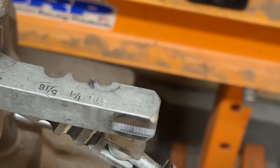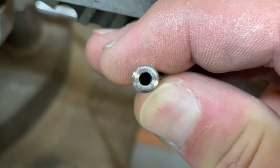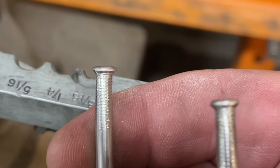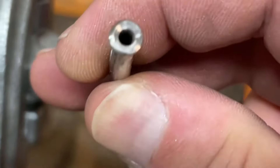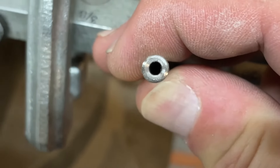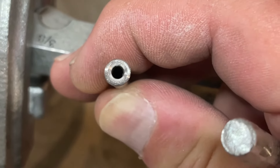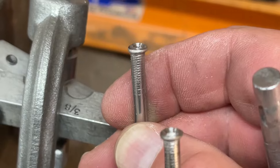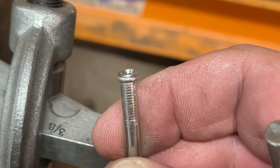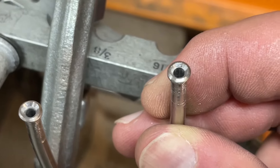There's the center of your flare. There's the shape of your flare. You can see how nice and concentric it is. The inside of that flare is going to seal up perfectly against the male portion of the flare when you're making up your brake lines and getting everything to seal. This is super important because if you do it any other way, you risk having a leak. And if it leaks, it's not safe.